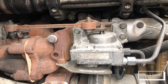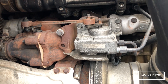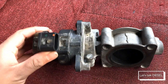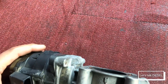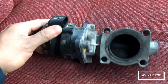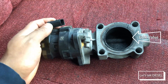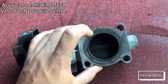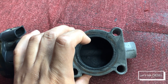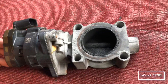There are so many kinds of EGRs that it's really hard to cover all of them in one video, but I'm going to try to show you more. This EGR here belongs to a Series 60 engine — it's really old, from 2008-2009 Series 60 engines, the last ones of their kind. You don't see this one that often anymore, especially here in California. As you can see, this one is completely loose — that's the way the EGR should work. We changed it because it has problems with the motor; there's an open circuit or something related to it.